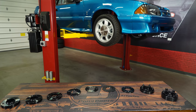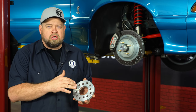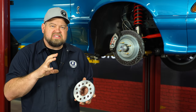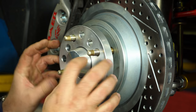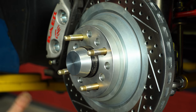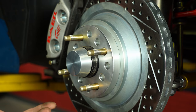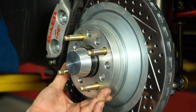The ones shown here are going to be versions of a lug hub-centric spacer — they're going to fit your car properly. We'll also show you one you probably wouldn't want to use. This is an example of a wheel spacer that will fit multiple lug patterns, but it's still lug-centric and also hub-centric. You want a spacer that has the proper edging so that when it fits on, it fits snugly. When this spacer goes on, you'll see it lines up with the lugs and it also clears the hub. You will have a little bit of play — that's normal. But the generic spacers from auto parts stores are going to have ovals instead of round holes, making them not lug-centric. This style spacer is going to fit the wheel properly, and when you tighten your wheel down, it's not going to cause any kind of balance issues.